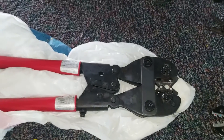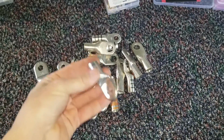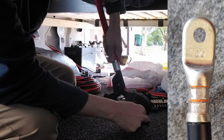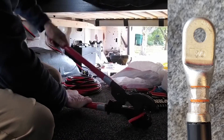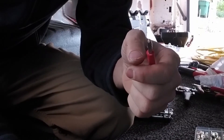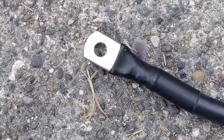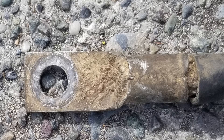So now I use the FTZ Correct Crimp and FTZ Power Lugs for all my cable crimps. This lever tool creates beautiful airtight cold-welded double crimps that will never fail. They're highly consistent and resistant to corrosion and vibration. I also coat the ends of the wire lightly with dielectric grease before crimping, and cover the whole joint with adhesive-lined heat shrink after crimping. Is this overkill? Maybe, but coming from the marine world, I know how quickly corrosion can destroy a connection, and the last thing I want is to be on a big winter road trip in Alaska and have a no-start condition because of a corroded ground wire. I'm not sponsored and have no incentive to recommend these particular products aside from having tried a bunch of things over the years and found what works best.